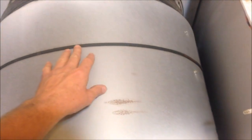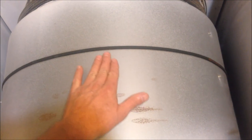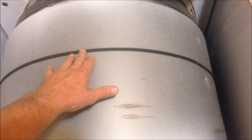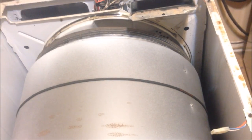I replaced this belt a couple years ago — it was making just a thumping noise. Every revolution of the drum was giving me just a thump. What I found was there was a little knot, a little raised area on the drum. When I filed or sanded down that little bump where the belt wasn't hitting anymore, the noise went away, and I went ahead and replaced the belt at that time. Now this belt is still good. My problem is likely going to be the rollers.